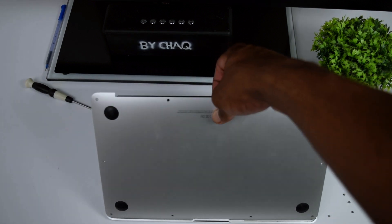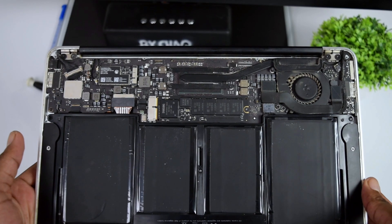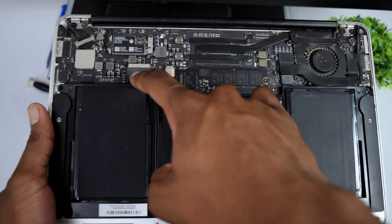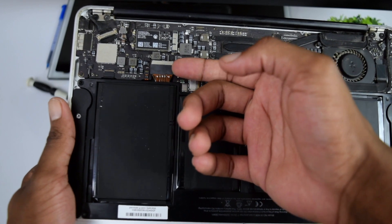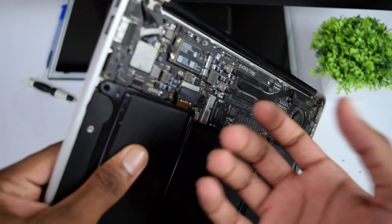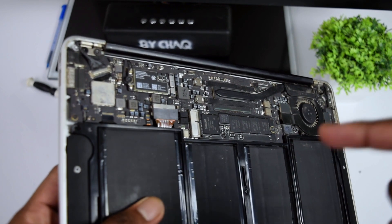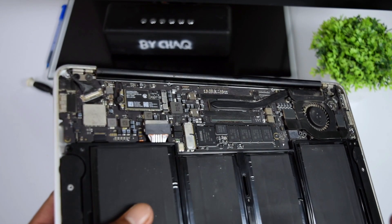Gently remove the back panel — this is what the interior of your MacBook should look like. All you need to do is disconnect the battery connector from the motherboard. Just push it gently upward and this is how it looks when disconnected. In some MacBooks you might need to push it down; just do it gently. If you have a different type of connection, leave a comment below and I'll guide you.